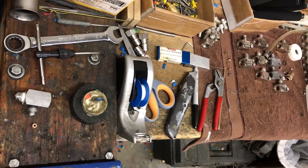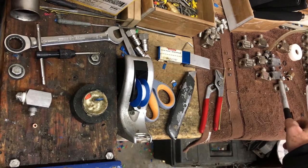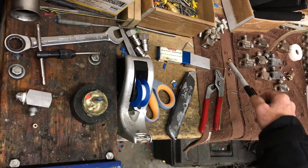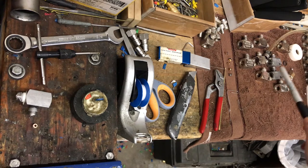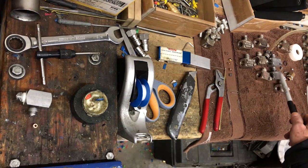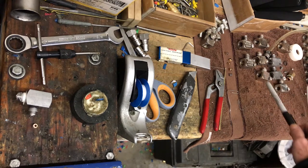Still in the middle of the Florida injector repairs. I've gone through these and marked or removed the nozzle bushing if it was brass or an incorrect size, and then I marked the age or the life left in the injector. Here's one of mine — ten years. Here's another one of mine — only got two years left. This will be interesting to see if it still draws when he sends it back in a couple of years. The rest of these are the Hydroforce types, different vintages, and they've all got between zero and three years left.